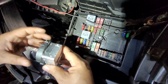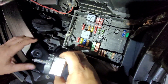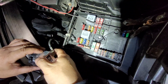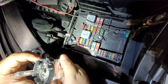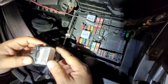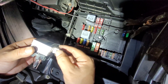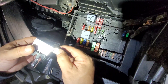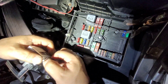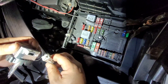So what do you do when you remove the bulb? It's really tight down here — this is the driver side headlight. You kind of twist it counterclockwise and then pull it out. To pull the plug out, you see this tab here — this is the unlock button. Press this and pull the plug like that. This is a locking mechanism, so just keep that in mind.